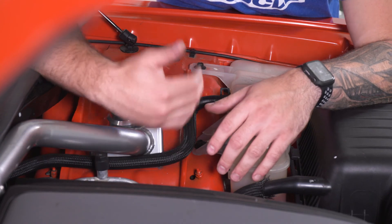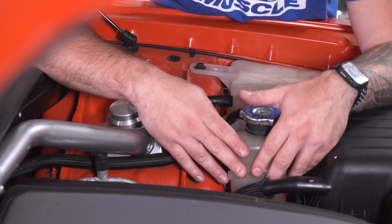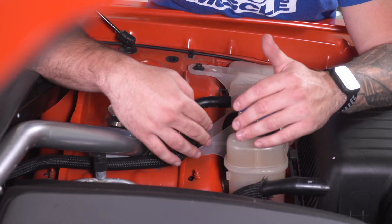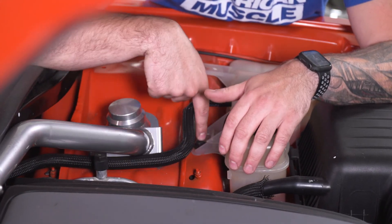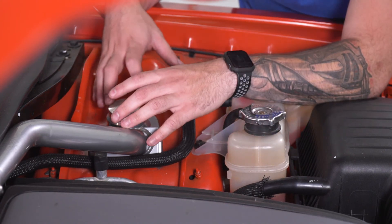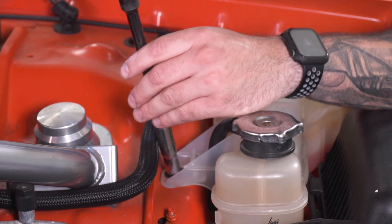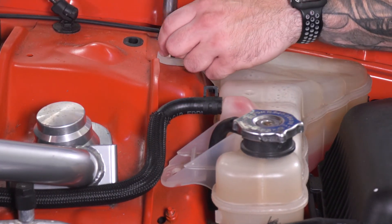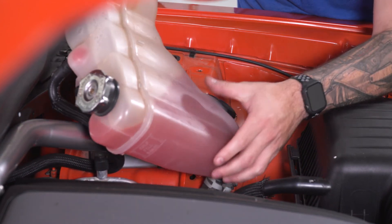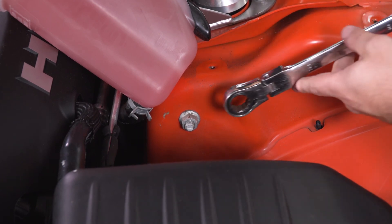Now that we're under the hood, I want to show you where the front bolts are. The front is right here on the inner wheel well, in between that and your coolant reservoir — this is kind of in the way. You can get a regular wrench in there and unbolt it, but it can be a little tough, especially when you go to reinstall. I think it's going to be a little easier to grab a 10-millimeter socket and unbolt the brackets so we can just lift this up without disconnecting any lines — just lift it up and set it off to the side to access those bolts.